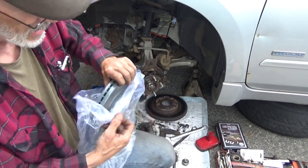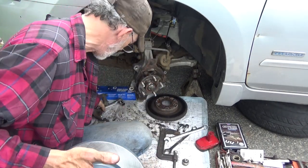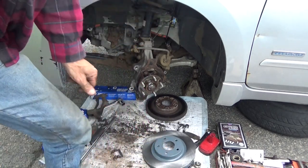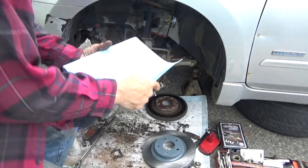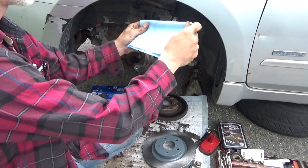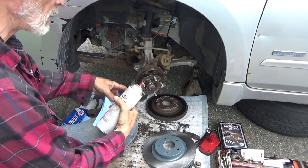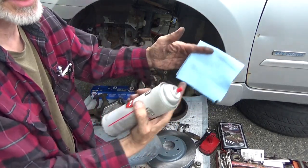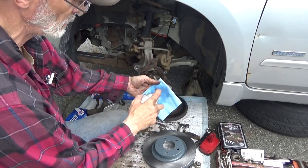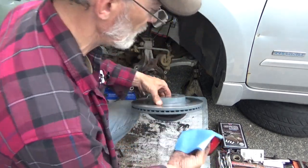This has a machining oil on it, so we're gonna need brake cleaner to clean this up. We'll move some stuff out of the way here. Spray that down. All right, blue paper towels. What I like to do, just to be not so wasteful, take the paper towel, fold it into 4. Take the brake cleaner, and keep in mind that this will disintegrate because of the brake cleaner after a short period of time, but wet it down really good. Starting to drip. Now use this to wipe down your rotor.